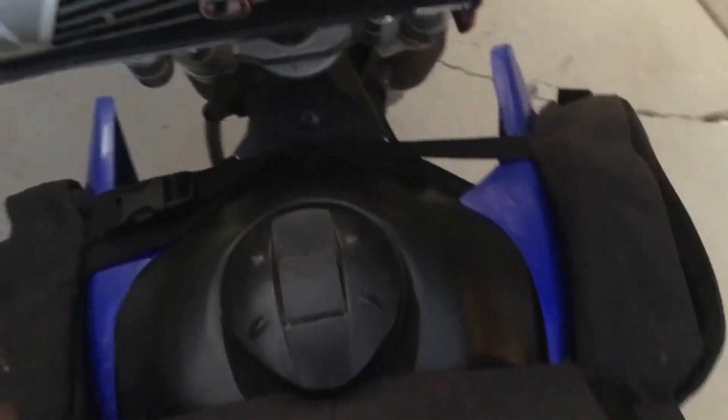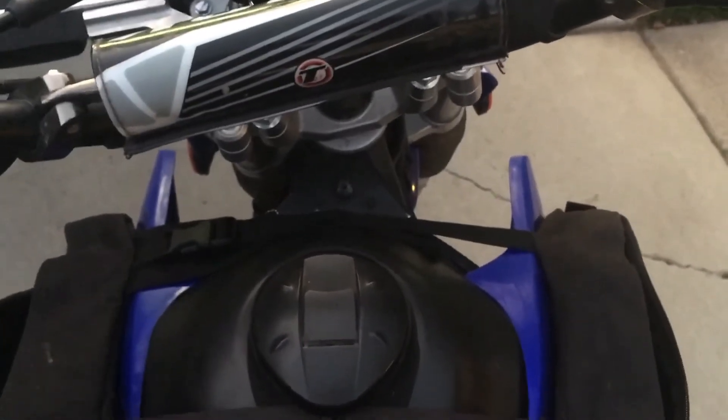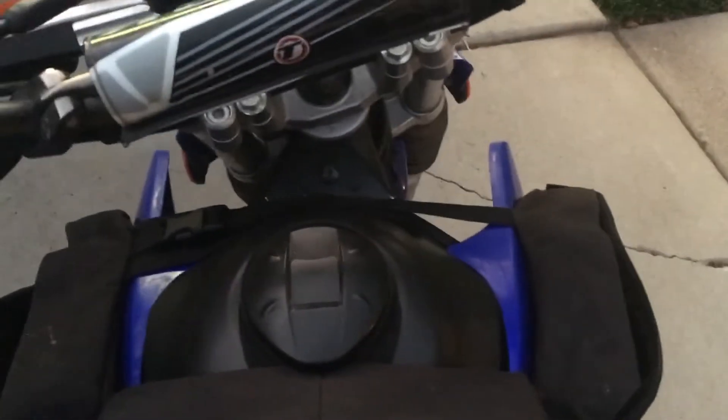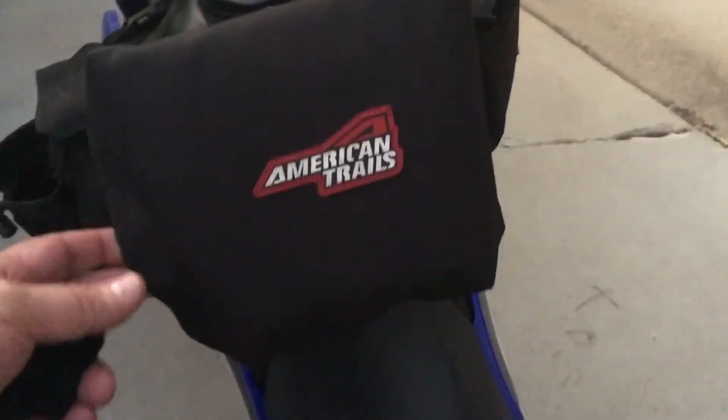Then you have a strap that goes between the saddlebags right across the front of your tank, and you can cinch this up tight. If you're not careful, you can cinch it so tight that the front plastics will catch on the air plastics, so I've set it up so I can turn fully and not catch them — but it's super stable. You also have these little adjustment clips on each side, so you can really dial it in. There's also a strap that comes off this buckle — I took off my seat, ran it down, and ran a zip tie from each side of the frame right about here, so it keeps everything solid. I go on rough stuff and I'm totally solid.